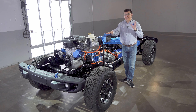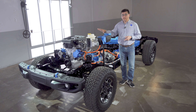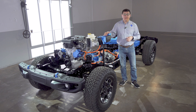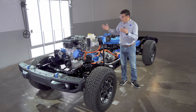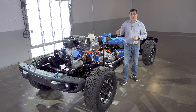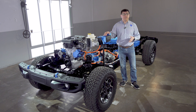Fuel economy does appear to be a little lower than the regular Wrangler, but that depends on how you drive. In a mountainous area, regenerative braking may make it more efficient on your daily commute. More importantly, this vehicle won't use much gasoline on the average commute — according to CBS, the average American commutes 16 miles each way, so only 9 of those miles would run on gasoline. That means even the slightly smaller gas tank in the Wrangler 4xe versus the regular model could yield about a thousand miles on one tank, assuming home charging only. With workplace charging, you could commute both ways using no gasoline at all.